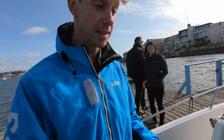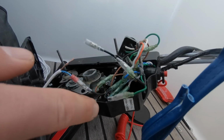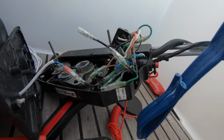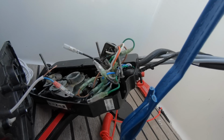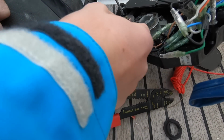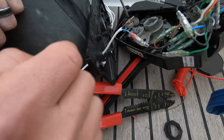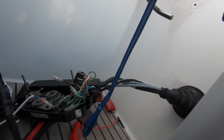For this install, just to make it a bit easier, it's sort of plug and play and connect. You've got your bullet connectors within this nest of wires. So we've used these Y connectors, which essentially gives you a parallel connection into your signal. So your black and green signal wires here, which are coming out from the back of your kill switch there. Then this is the cable that we're running as an extension. So you've got your blue and your brown. These attach onto bullet connector, plug into there. Then you've got your signal wire cable essentially, which will run back through the plate, back through the side there, and then just gives you complete access to the Guardian behind the scenes, behind the steering. Cool, perfect.